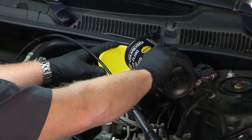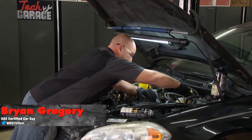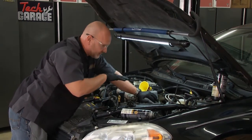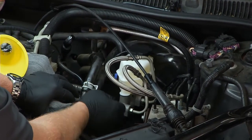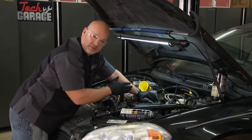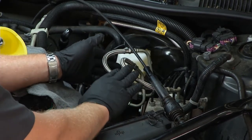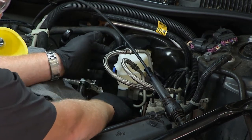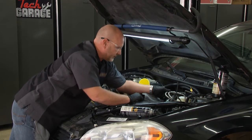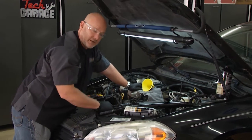Just topping off the master cylinder after the bleed — the reservoir is exactly where it's supposed to be. Here are a couple of good wrenching practices when replacing a master cylinder: when you remount it to the firewall, leave the nuts a little bit loose to give yourself some slack so you can get the brake lines properly reconnected. You don't want any chance of cross-threading or imperfections on the flare — you've got to get a good seal so it won't leak. Also, if you have perfectly matching brake lines, label them or take a digital picture before disassembly so you know which line goes into which port. We've bled the system — imagine the work if we hadn't bench bled it first.